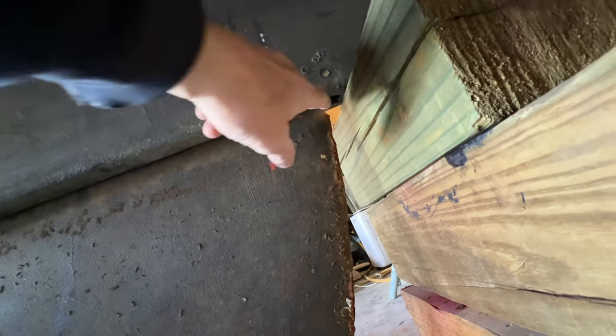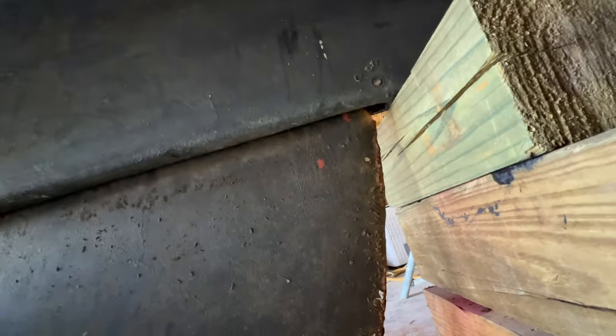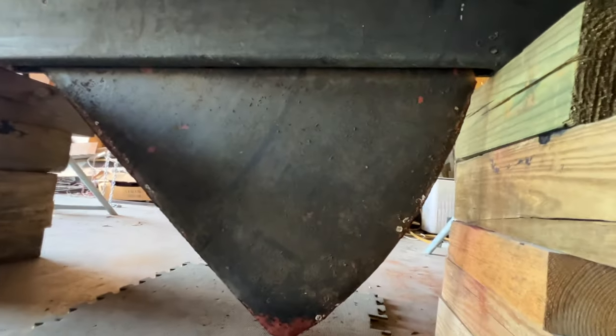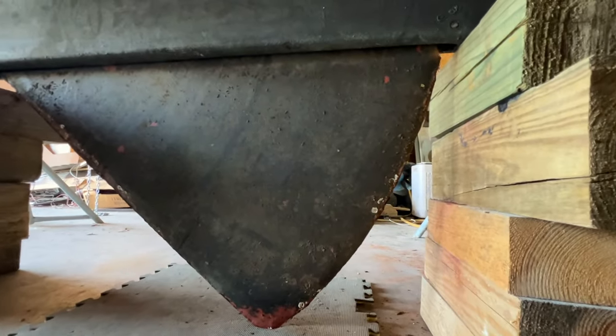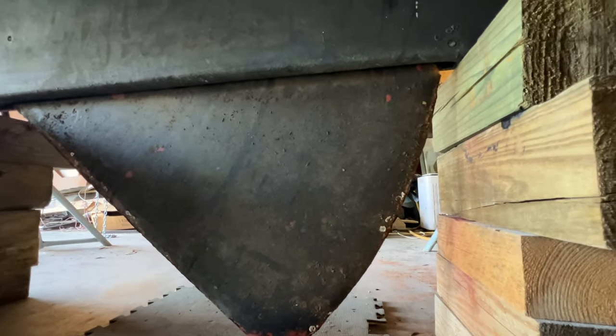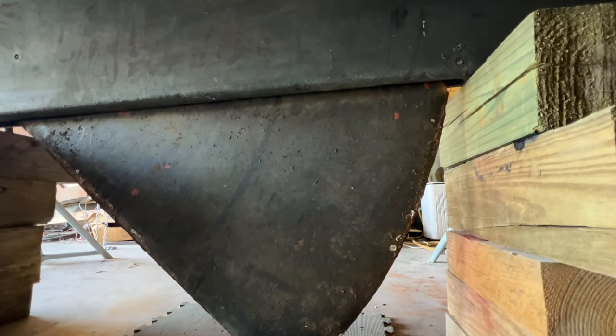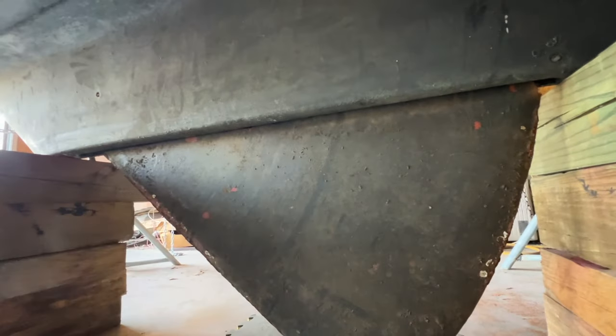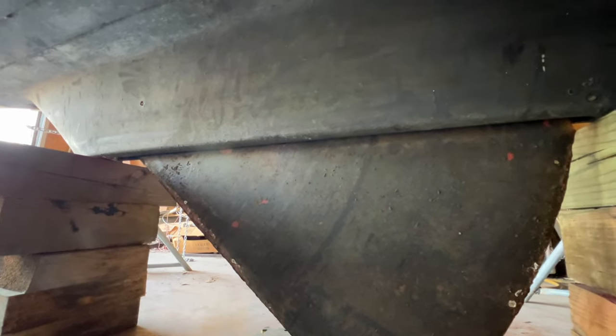did drop it down far enough to see that, because this is a 170-pound cast iron swing keel. You don't want it suspended just from the pennant only. It's just a little bit too much weight. I mean, the rope will carry it, but the pennant line, which I think in this boat is 5/16 double braid, would wear a whole lot faster with that 170 pounds hanging off of it continually while you're sailing.